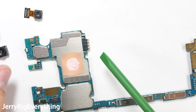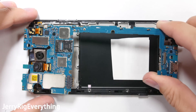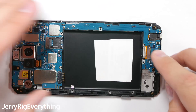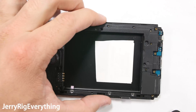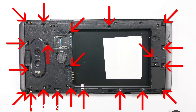I'll clip the cameras back into place — make sure you get them back into their correct slots and orientations. The motherboard will sit perfectly on the frame of your new screen, and you can clip the screen ribbon cable back into place at the bottom. Then I'll set the back plastic piece down on top of the main board with each of the two little end caps and all 21 screws. There are an incredible amount of screws, but at least the phone has a solid build quality.